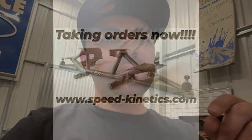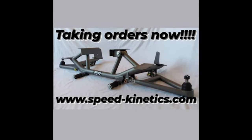I've never set an engine up with a motor plate. So I think what I'm gonna have him do is the stands that come up, and I'll put a picture so you can see what his K-member looks like. But the stands that come up for the engine mounts, I think I'm just going to have him tack those, because this car's going to have a mid and a motor plate. So I'll have him tack that stuff in, and then maybe have either Tony or Kelly help me get the block set up in the engine bay with motor plates, and then I can cut those pieces off since I won't need them.